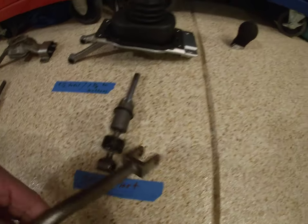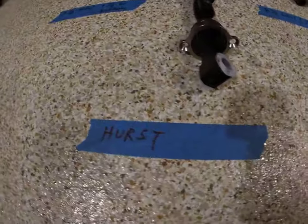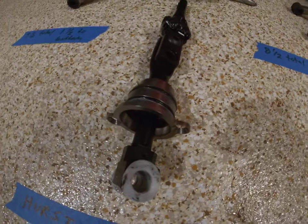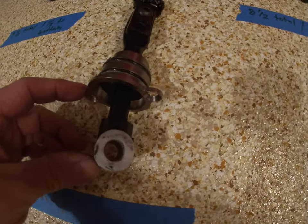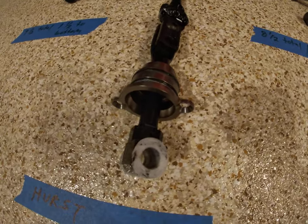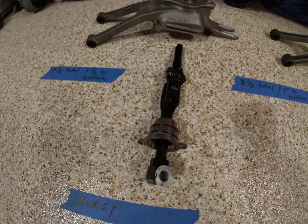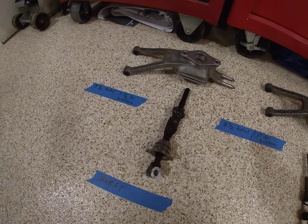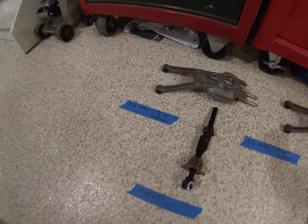What about the Hurst? They were good back in the day, and it's just a simple replacement arm again. They did some nice things tightening up the bottom into the housing, but the overall length is a little longer and you see a big jump on the bottom side as far as the distance, which really changes the throw. It's close, it's mechanical, it feels great, but I think they got a little too greedy — I've had issues with this shifter causing the transmission to grind. Barton is very similar to the Hurst and I've read online where a lot of people have had grinding issues. It is so much less expensive to buy a shifter than a transmission.